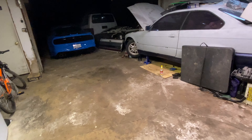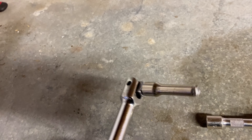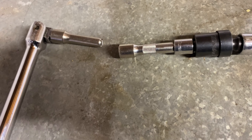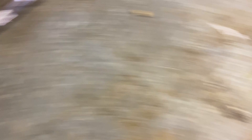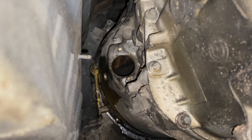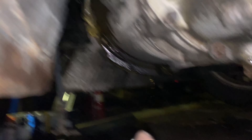Since the impact driver doesn't seem to be doing much, I went ahead and grabbed the breaker bar and put it on all my extensions to try and break loose the remaining bolts on the transmission — and then this happened. Yep, that is snapped off within another extension, and I did this by hand. I thought when it started to move I was actually breaking it free; all I was doing was breaking my wrench. So I'm going to crawl underneath and cover all of these bolts with PB Blaster.